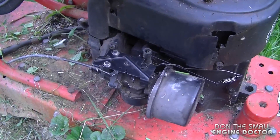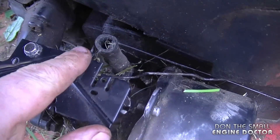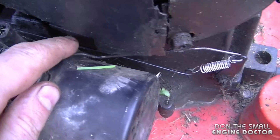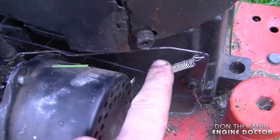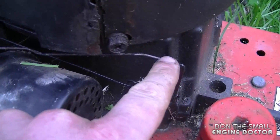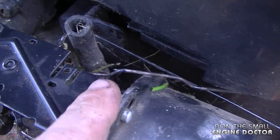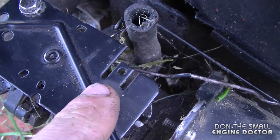When the throttle is wide open, you can see the spring tightens up. Here's one last good view: the throttle cable, and the other linkage that goes underneath and attaches to the second from the top hole with the spring. The other linkage goes above the one with the spring and attaches to the butterfly mechanism on the carburetor.